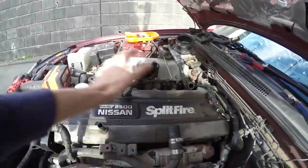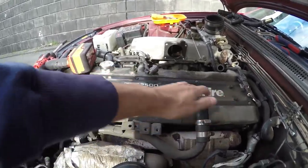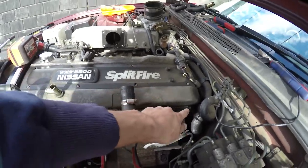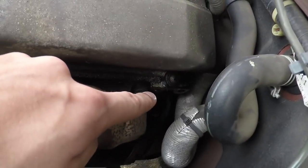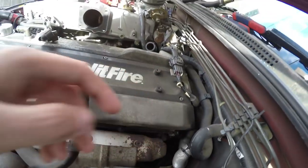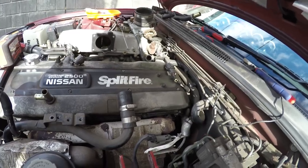So I've taken everything off the top of the engine that's preventing me from getting the cam covers out. The last things left to do are take off the valley or the coil pack cover so I can get to the bolts on the inside — there are bolts along the outside and the inside. Once you get those off, they lift right out. Now what I wanted to show you is this is exactly what I was talking about where the seals start to leak and the oil starts weeping out of the side of the head and dripping down your block. It's nasty. If you've ever owned an RB, you probably know exactly what I'm talking about.